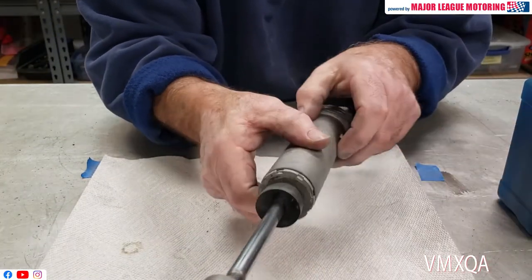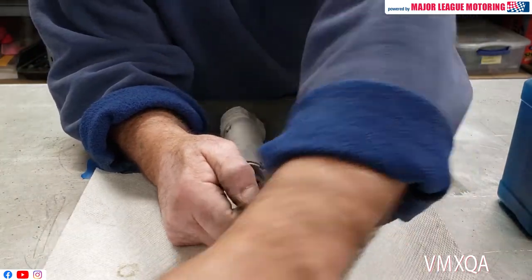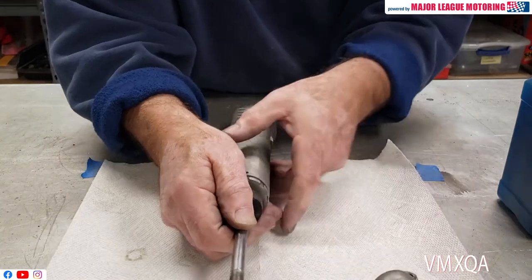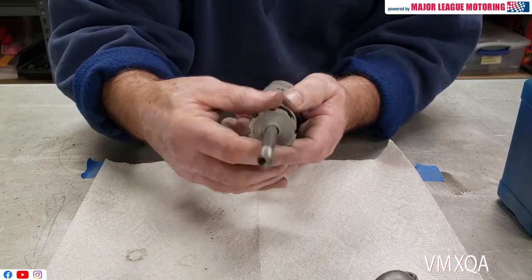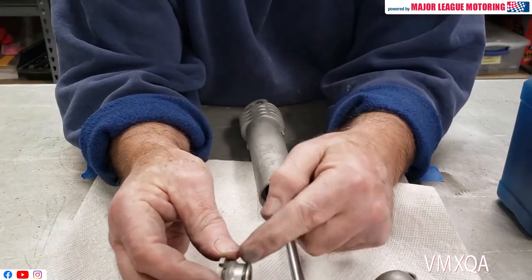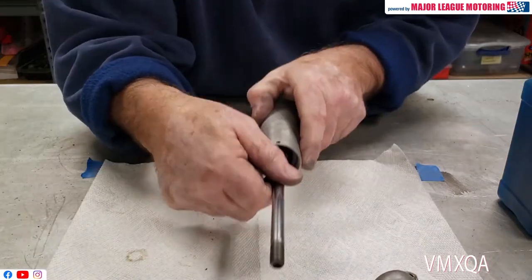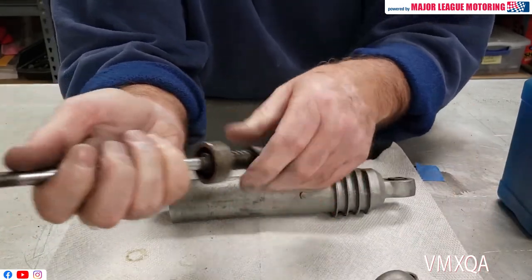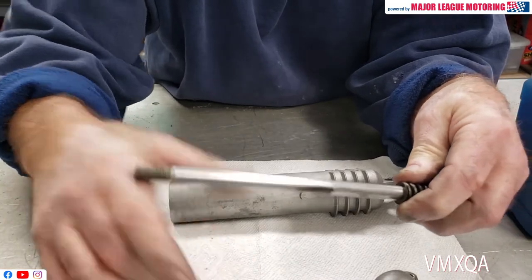I have another shock here after it's all been taken apart. You may need a special wrench to get off the piece at the bottom. But right now you have a lock nut at the top with your eye — with your eyelet. You want to take that eyelet off, get the nut loose, and you're going to be able to get this head off. On there you're going to have an O-ring, and there's a seal head inside. These things are still available — I got mine from a supplier at Osa Planet. When you pull that shock apart, it is going to have oil in it, so be very, very careful.